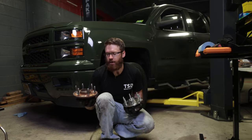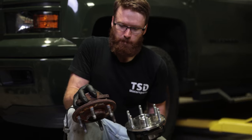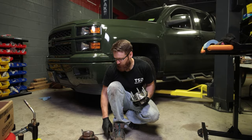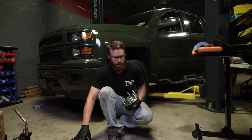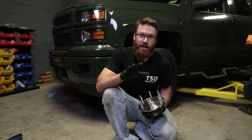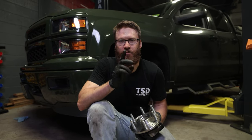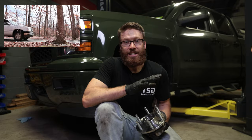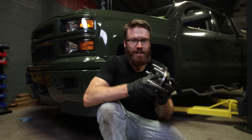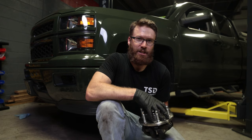Here's one of the old ones I got out already before we started filming — I already did the passenger side. As you can see, this one is pretty corroded. My truck was starting to make some weird noises from the front end. I have 140,000 miles give or take, so I decided to upgrade the wheel hubs in case that is the source of the noise. If you want to know what a bad wheel hub sounds like, Pete has a video up on his 2004 Silverado — that is not a sound you want to hear. If you hear that sound, replace your wheel hubs immediately. Anytime you start hearing a sound from your wheel hubs at higher mileage, it's probably a good idea to change these out.